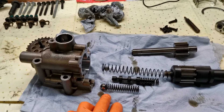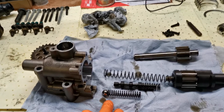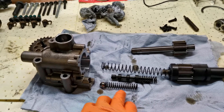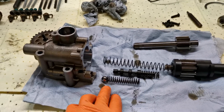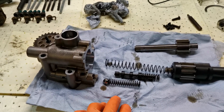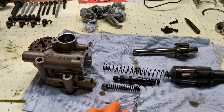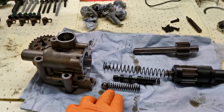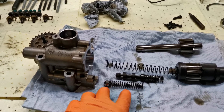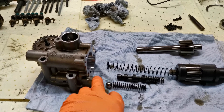What we're going to try to do is figure out how to get maybe 70 or 80 psi of oil pressure. Typically you would modify your pressure relief valve here. One way — the quick way — is to simply stretch the spring. Another technique, probably better, is to leave the stock length but run a smaller spring on the inside, which creates a stronger spring as a pair. The flow will then allow pressure to get higher before the ball is forced back, causing it to recycle.